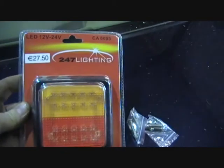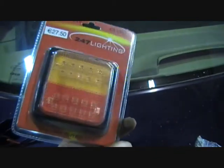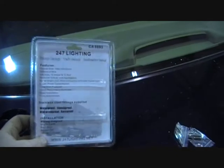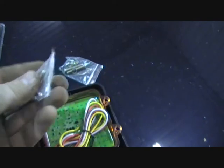What I have to replace these are LED lights, and these are quite good quality ones. An advantage of LED lights is that they don't have bulbs, so they're much more reliable and much brighter. These are multi-volt ones — 12 and 24 volt. Some people say they have problems with just 12 volt LEDs when you start the vehicle, as it charges at about 14.4 volts, which can cause issues. But these are rated for both 12 and 24 volt, so these should be fine. They seem to be pretty good quality — they even give you stainless steel bolts to hold them on.